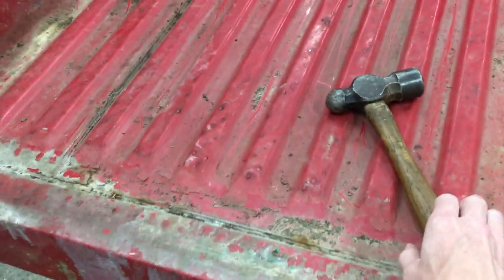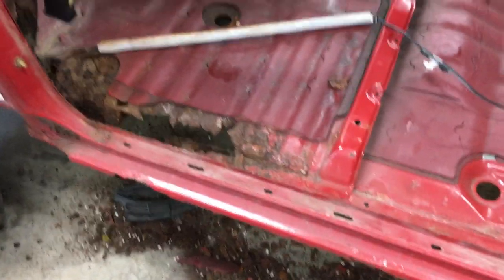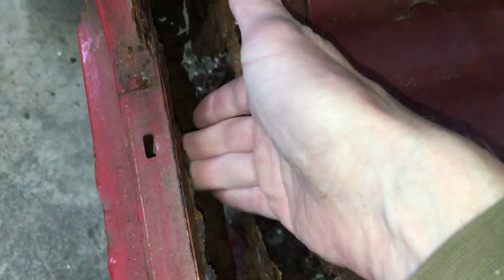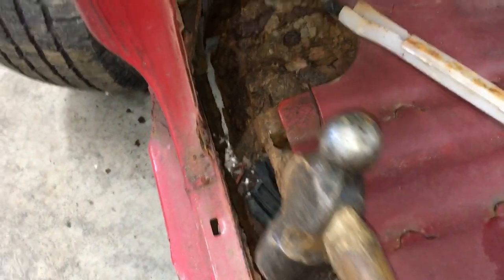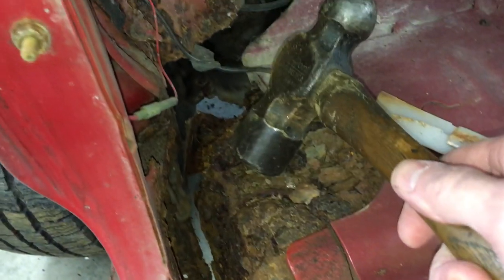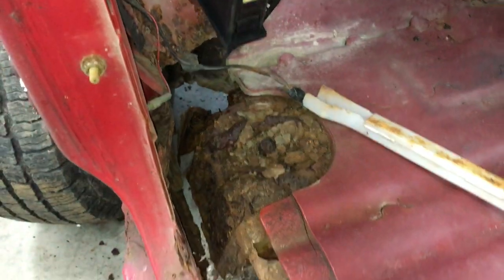Let's go look at the driver's side — it's actually worse. So you thought the passenger side was bad. There's the actual rocker panel right there. There should be a piece here that sort of covers the inside, and that's completely gone. This is all hollowed out now. Not to mention where the floor attaches is gone, and that goes all the way up into here. There's the mount, so really the mount isn't even holding up the outside of the body right now.